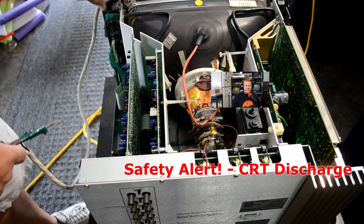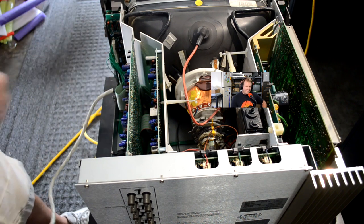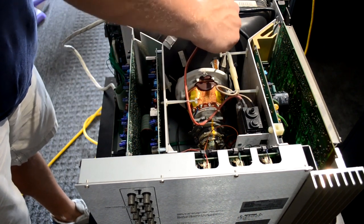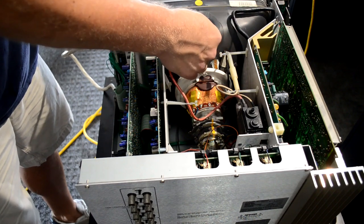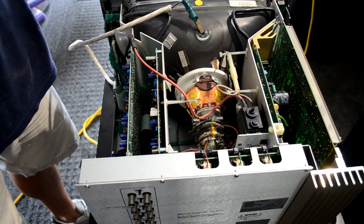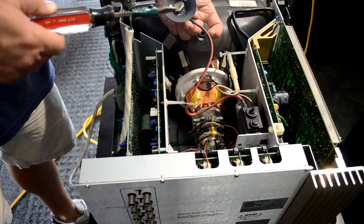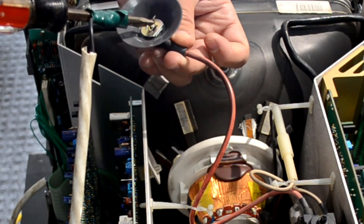Safety alert — we're about to do a CRT discharge. I've added a nice little alligator clip to my discharge tool, but please note there's nothing else in the line — it is just an insulated cable tacked on to a screwdriver. The first thing to note is I'm not discharging it until after I pull the anode cap. I only recommend doing that on higher-end monitors, because if you just press the end of the screwdriver into that hole you could damage the back of the glass tube and scratch it. Of course, I don't recommend doing this unless you're extremely knowledgeable and know what you're doing.